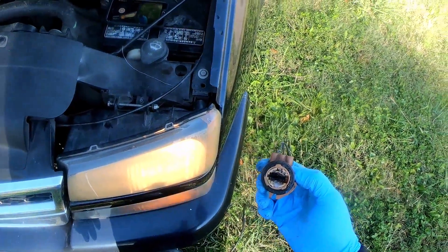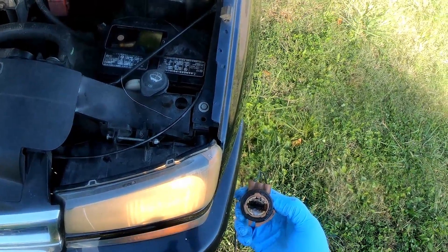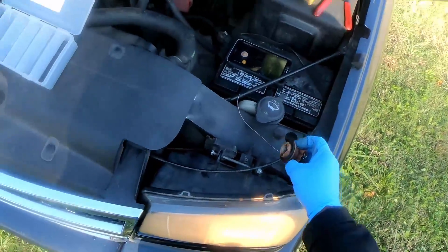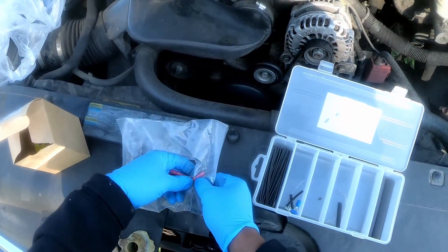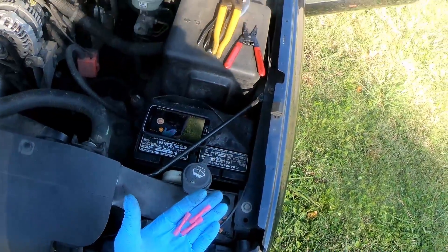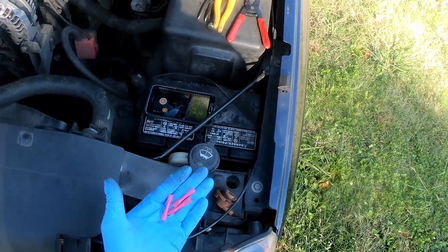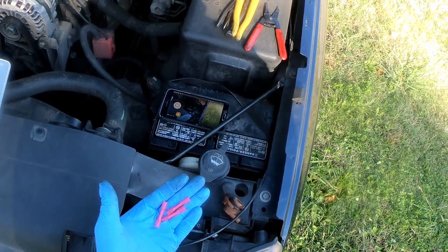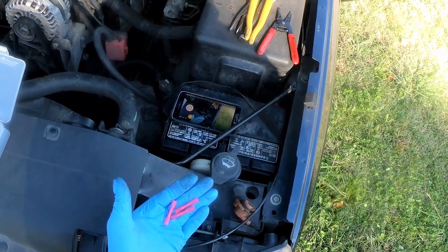Not a bad repair, it's pretty simple. Didn't take me no more than 10 minutes to knock it out. Shouldn't have any more problems. I chose not to use these butt connectors — just past experience, they give intermittent connections and are kind of problematic. I believe what I did is a more permanent fix and shouldn't have any intermittent connections.